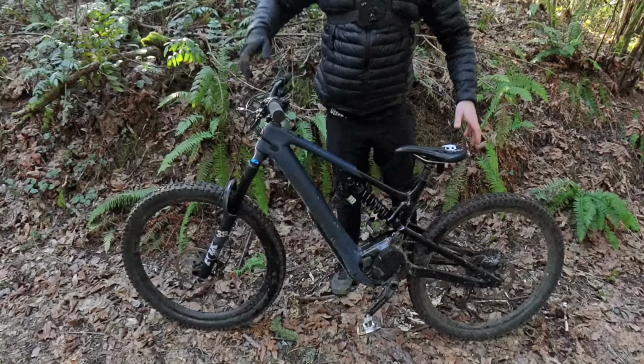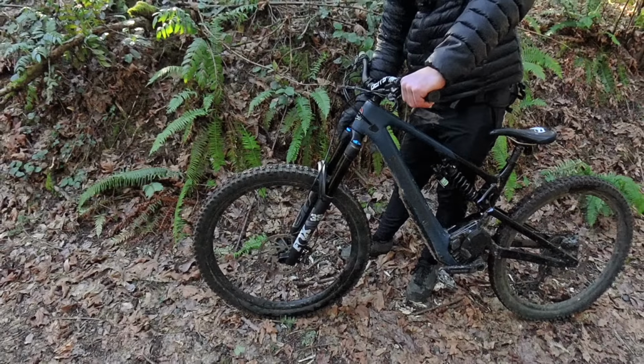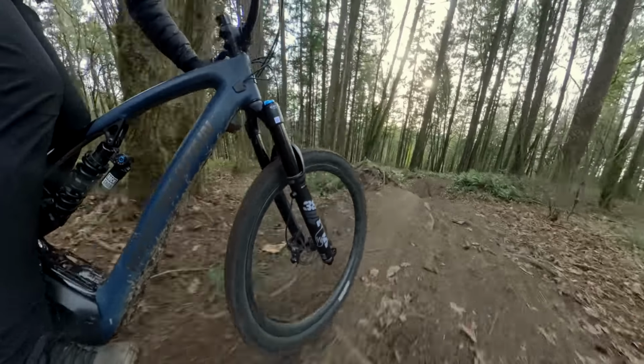There is certain exceptions to this rule, like a push 11.6, I can use a 500-pound spring. But remember, we're dealing with Rockshox here, a very primitive damper. I wanted to run a little experiment for the setup video, so basically I put a 500-pound spring on the bike, and then I went out and rode it for about a week.